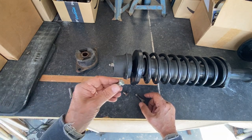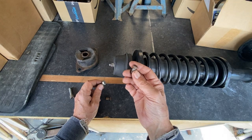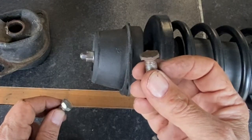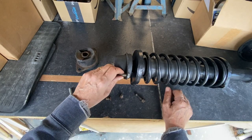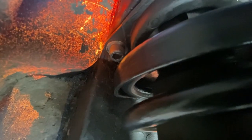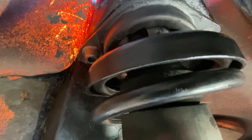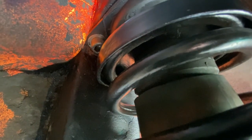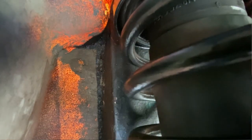On the outboard side, because it's so hard to do up these bolts you can hardly get on the flanges of the nut — as you can see, this one's all chewed up, that's just from getting it off. I'm going to put an ordinary bolt in on this side. You can see the back bolt up behind and how it's fouled by all the bodywork — I've got to move the strut out of the way even for you to be able to see it. So getting a spanner on a nut or bolt head there is almost impossible, whereas with the cap head I can put a ball-ended Allen key in and get it done.